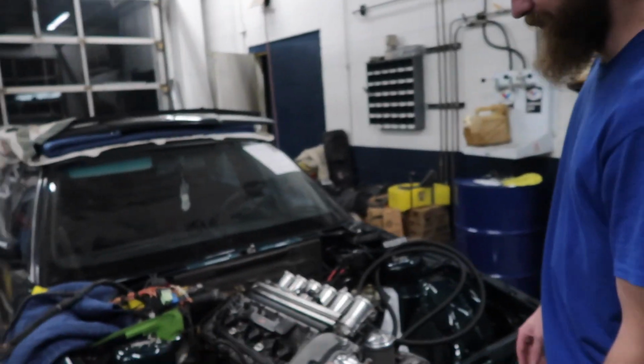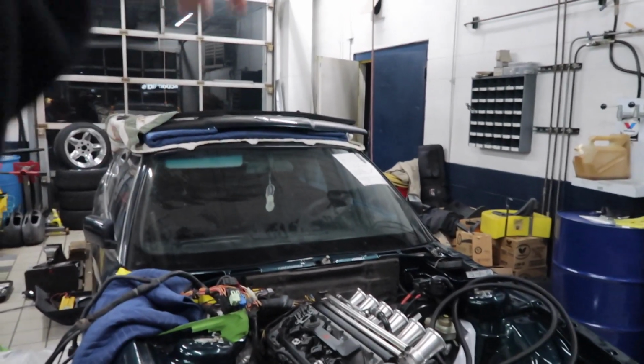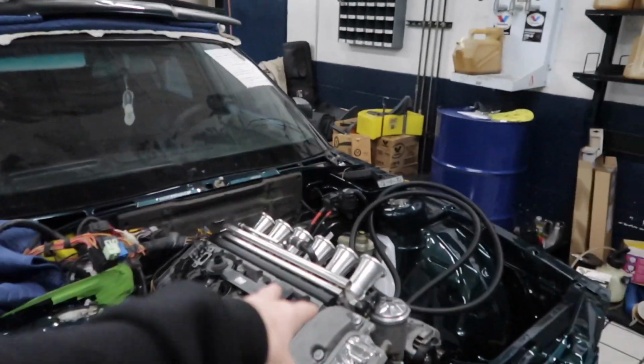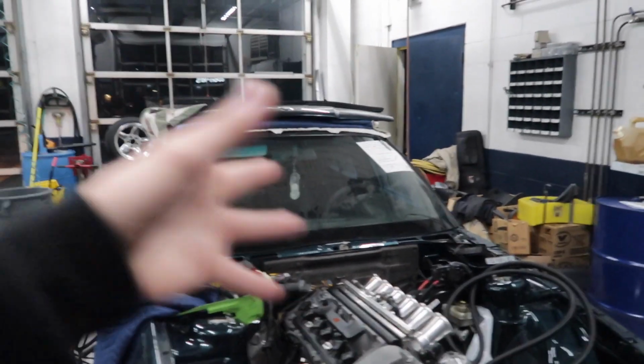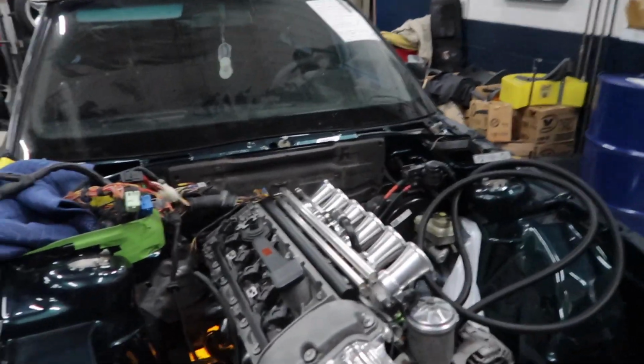Yeah. But basically, what he's saying is, if you had a 91, 92 525i, you'd already have the trans and the drive shaft. You wouldn't have to touch anything from the way back because it would bolt right onto the S54. But he did not have a ZF car originally. It was a Getrag car, if you didn't know. And I mean, other than that.